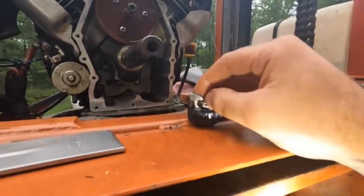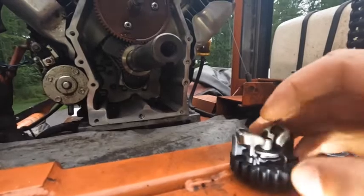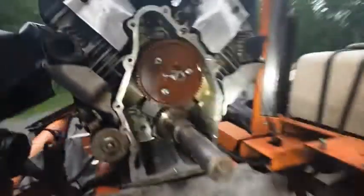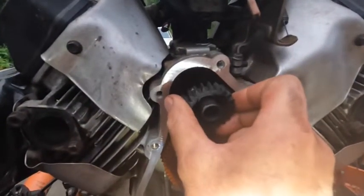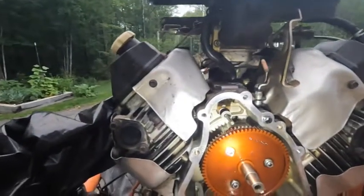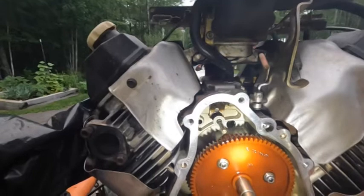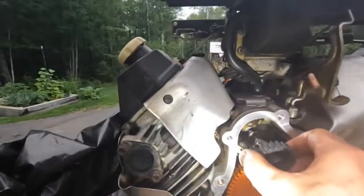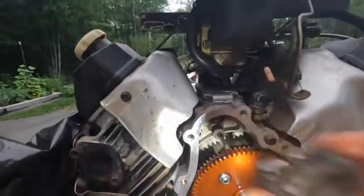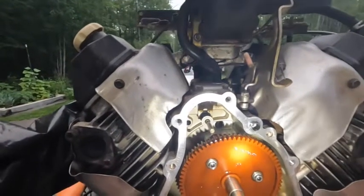Like this, roughly — this end of the spacer is like so, they nose into each other. That one's back, this one's front. This assembly slides over that until it locks into the detent — and that is basically it for this assembly. There's another style depending on your model number that uses a different setup, and it comes with balls, so you've got to check your model number. This CH980 — this is the setup it has. So after we get this on and engaged with the gear, this does not have to be timed with the gear. It's more confusing to say than it is to do.